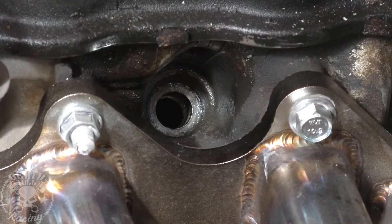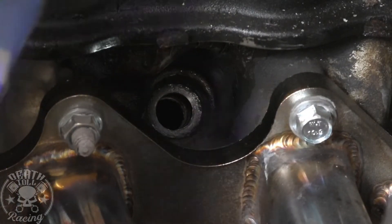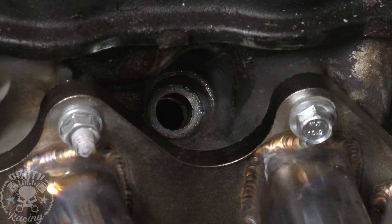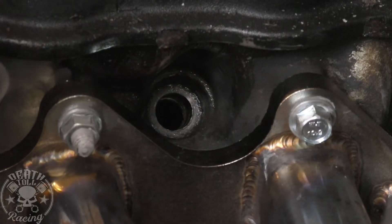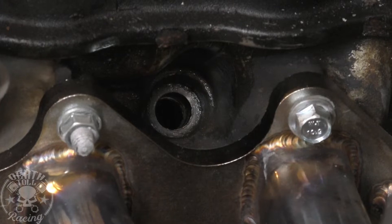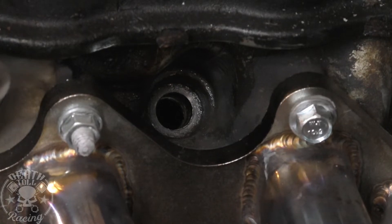There's the hole — we've got a good camera angle on it. The threads are stripped, but as you can see, it has a lot of threads, so it's really surprising they stripped out. Someone must have over-tightened them at one point. I also noticed when I first got it, before we changed the spark plugs, it had what sounded like an exhaust leak that went away after we changed plugs — it may have been those threads were already giving out.